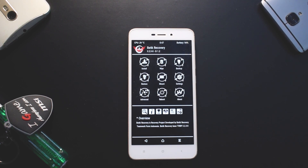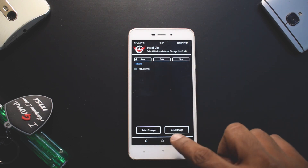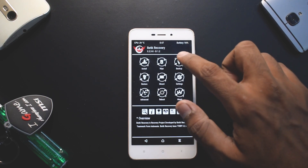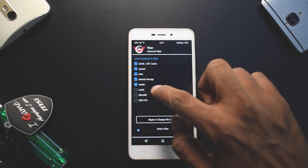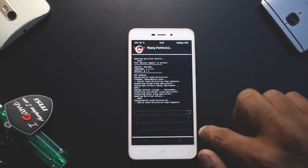To install the recovery, go to Install, select 'Install Image,' find your TWRP image and flash it — it's also available as a flashable zip. Now go to Wipe, then Advanced Wipe. Select Dalvik, System, Data, Internal Storage, Vendor, and Cache — everything apart from Micro SD and USB OTG — then swipe to wipe.